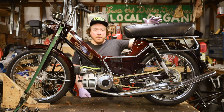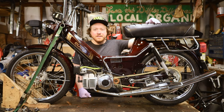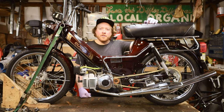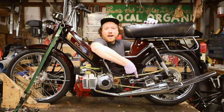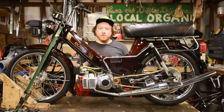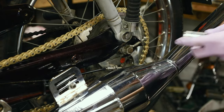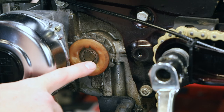When it gets hotter outside we might have to put in a slightly smaller jet like an 81 main, but I think it'll be fine all year round. Today it's 65–70 degrees so that's pretty good. One thing I noticed — and we talked about in an earlier episode — is that this chain might have to get tightened after the first ride, and sure enough it did stretch a little, so I'm going to move the rear wheel back a bit and loosen the axles.